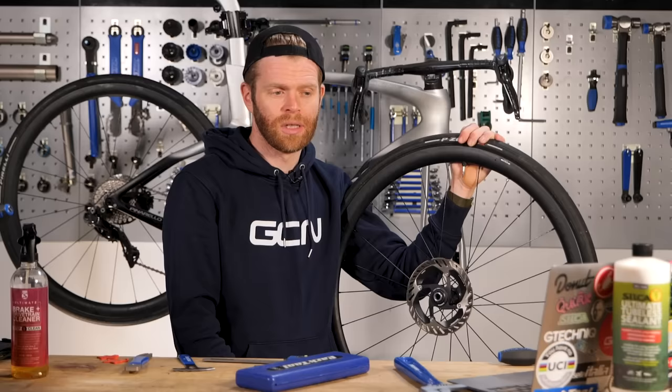Dragging your brakes. If you can learn to brake properly, your brakes, pads, and rotors will last longer. This is because braking is all about heat dissipation — or increasing entropy if you're a nerd. If you drag your brakes all the way down a long descent, it builds up loads of heat which will cause the brakes to wear out more quickly. If you learn to brake properly — braking into a corner and then releasing as you exit, then braking again at the next brake point — you're giving your brakes a chance to dissipate a lot of heat in a short space of time, which they're designed to do. As a result, your brakes will work better, they will last longer, and you'll just be a better descender.